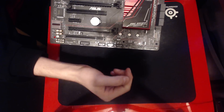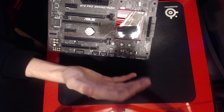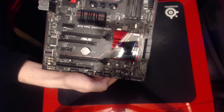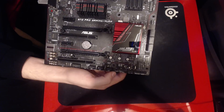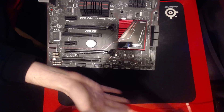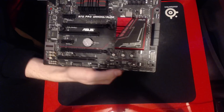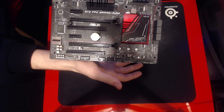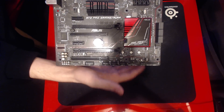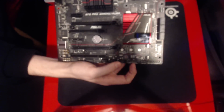There's also the retry functionality. What retry does is it basically quickly resets the motherboard and forces it to try again. Very useful if you're trying to get some very difficult memory settings to boot up. If it fails to post once, you short the retry pins a few times, and eventually it might actually be able to post after a few retries.